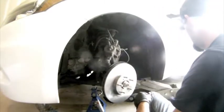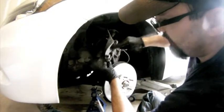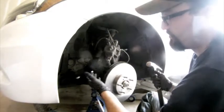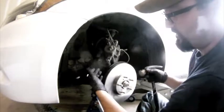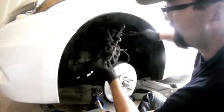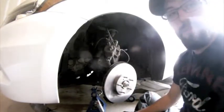One thing I like to do is just tap the top of the nut a little bit. I don't know if this actually works or if it's just an old wise-man myth, but I was told it helps the penetrating oil get into the threads a little bit faster. We're just going to let that sit for 15 minutes and then get back at it.